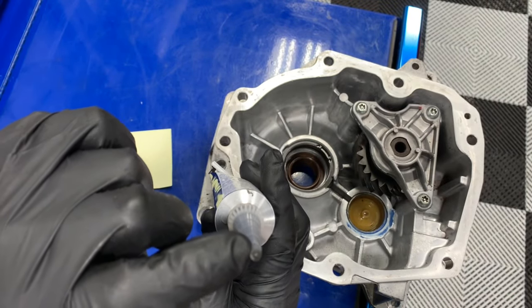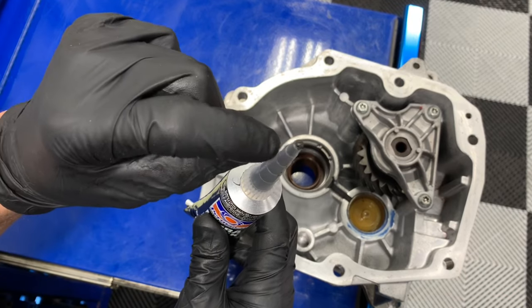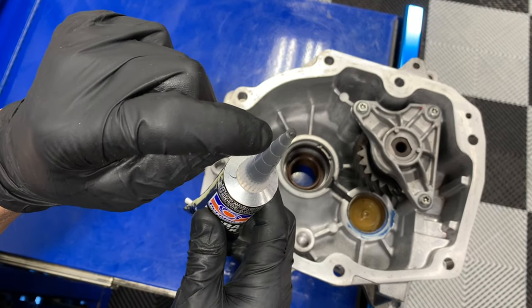I've got mine set at about 2 millimeters of bead thickness. Every time you cut it, it'll expand it — maybe 4, 6, 7, or 8 millimeters — or you can take the top off and just goop it on there.